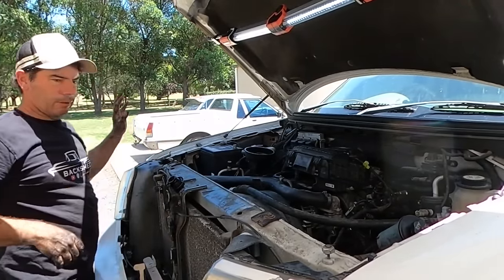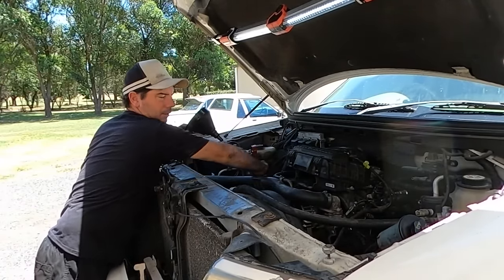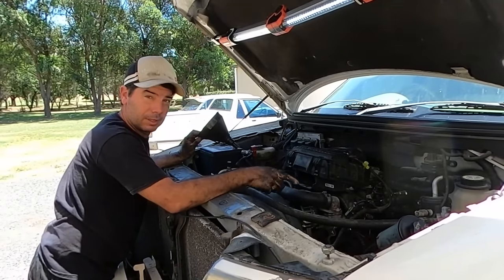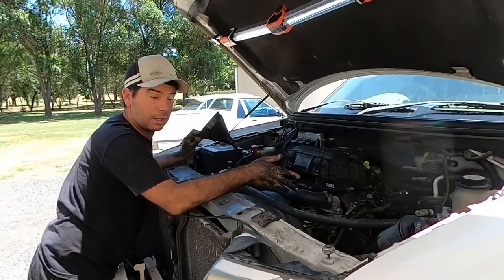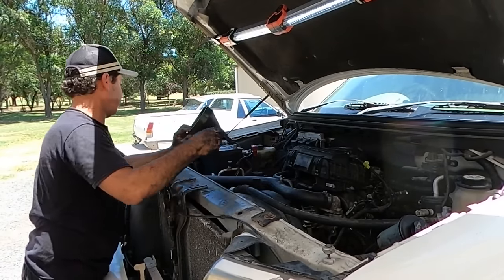Let's just put the oil lid on it and run it and see what happens. I've lost nothing by doing that. If we end up, it has jumped a tooth, then we'll just fix it. We'll just take the timing set off, retime it, maybe put some new chains in it, and then find out it's got a bigger knock. No, I don't know. Anyway, let's just keep going.